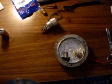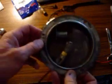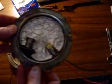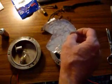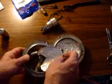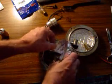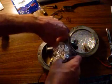It's a strong, brand new spring. Twist it and it's in there. Because these are old cans, I cleaned them up but they don't really shine. I want a lot of reflection, so I took some foil and put that in there. I made a piece using the other side as a form — it squished in here, and I cut out a notch for the other unused lamp socket. We're not going to use those extra sockets anymore since we're now at 12 volts. The foil just slips under there, under that bulb.